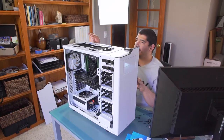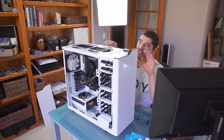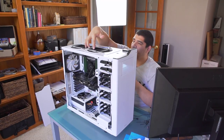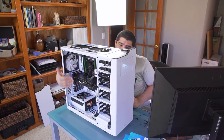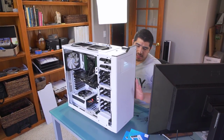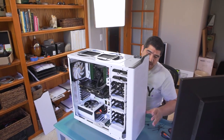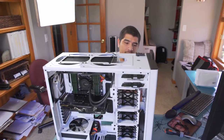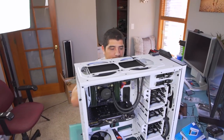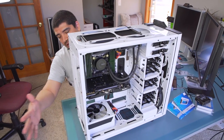And actually the top of the chassis, while it's covered, does have side inlets surrounding it. So that means cool air will come in, then be drawn in here, and then be blown across the motherboard. So the top portion, which is the hottest operating portion. Here on this side, the chassis has side intakes, so that'll help to draw air in, and then we've got these large fans that'll bring in air and draw it across the motherboard, and then it will exhaust outside of the chassis.